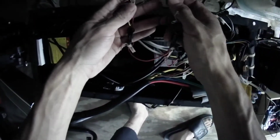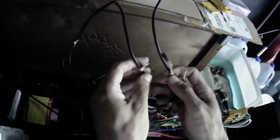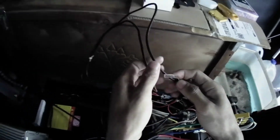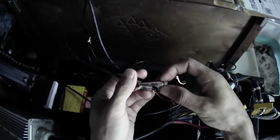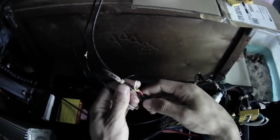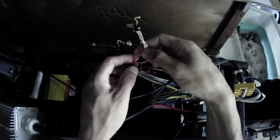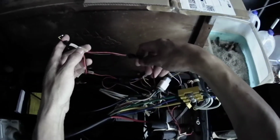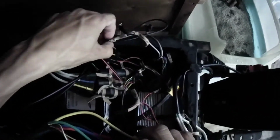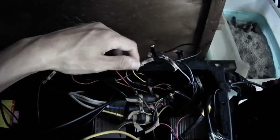If you upgrade your headlights or replace them, these are headlight wires, one for each, one for left, one for right. Left headlight, right headlight. They're individual. You connect them to your cable, your positive and negative. And this also connects to your light horn switch unit wire here.